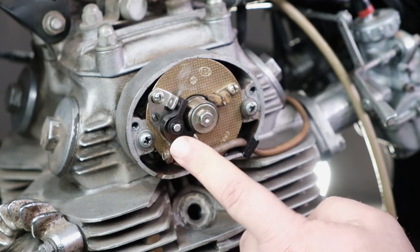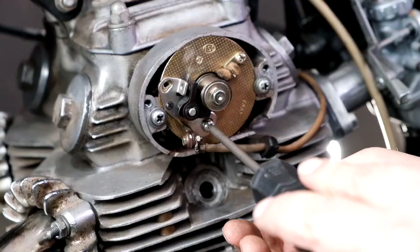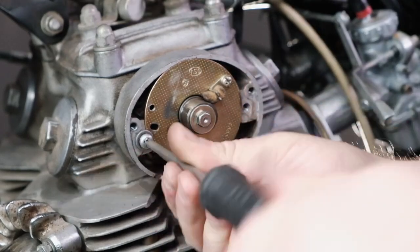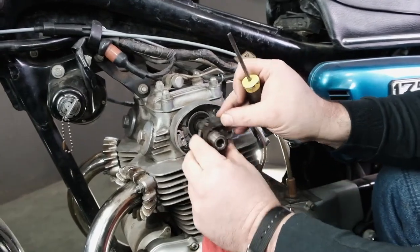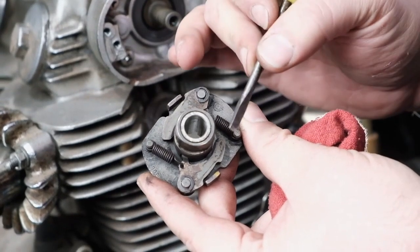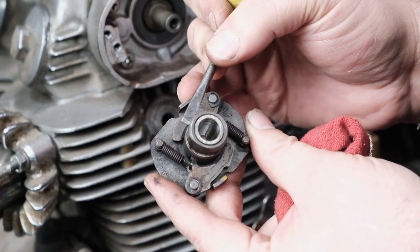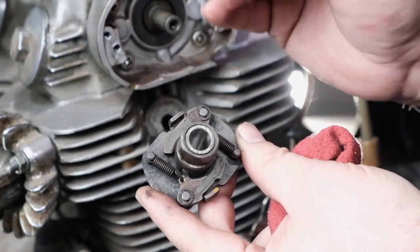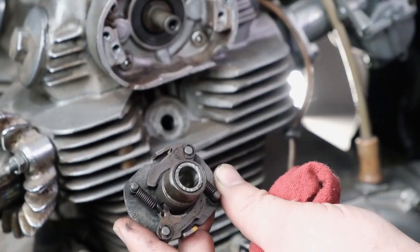On our particular bike, this is a set of Hitachi points — you could have Hitachi or Nippon Denso style. The screws are a little chewed up, so I'm going to swap them for Allen head bolts and take the plate off to show you the advance mechanism. This is our advance mechanism, and on these 175 and 200 advance mechanisms, there are actually two lobes on the cam. You can see how it ramps up on each side. When we go to set the point gap, we're going to set it right at the highest spot on the cam lobe — roughly where the end of that little weight finishes — and then 180 degrees from there.